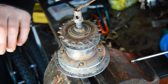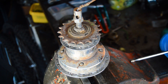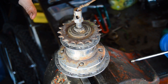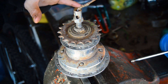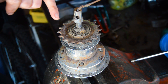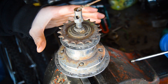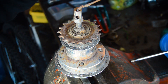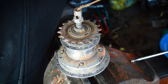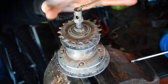It's a 3-speed hub. The aim is to get this working again, like I've done before on a regular 3-speed. I do have two others to do as well and both of them are seized, so it's going to be a challenge. First step, as always, is to soak it in WD-40 for a week. It's Saturday now — I'll rejoin this next Saturday after it's been soaking.